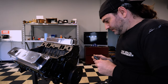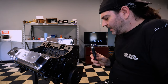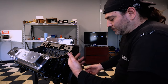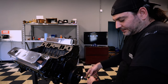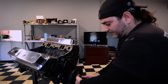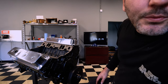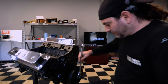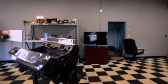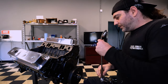She's on now. This balancer installation tool makes it so much easier. I've heard people say it breaks on them but I haven't had one issue. You take the piece that screws into the crank, and there's a long screw that runs through the center of the shaft - screw those together into the crank. Then run a bolt up against it - it's a one and a quarter inch bolt.